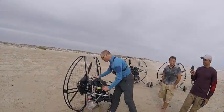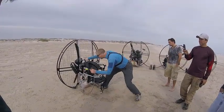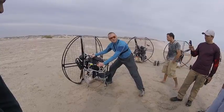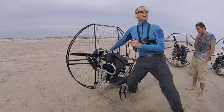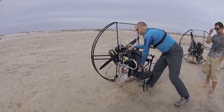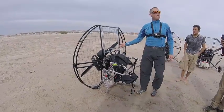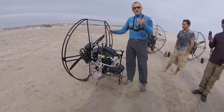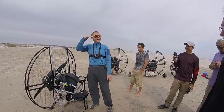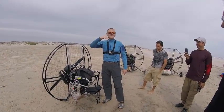Okay, now for our motor run up. Once we get it running, you want to run it for a while and keep an eye on your fuel filter. If you start running at full throttle and your fuel filter goes empty, it'll run out of gas. So if it starts running out of gas, you just reach down, hit your primer bulb, and prime it again while it's running. Then you run it a little longer, you watch your fuel filter and make sure it's holding a constant level. It's not going to stay full, and it can be fairly close to empty, but it has to maintain a level.